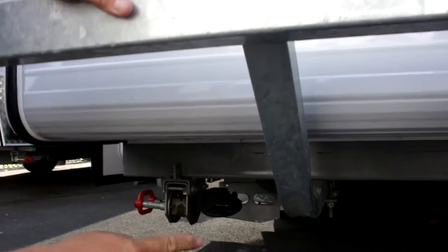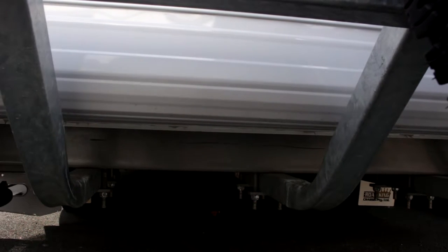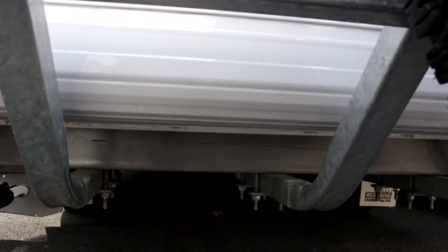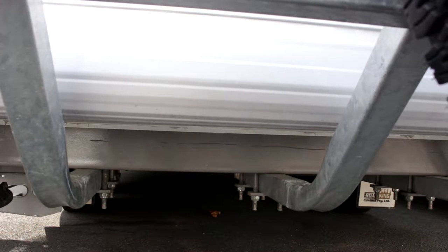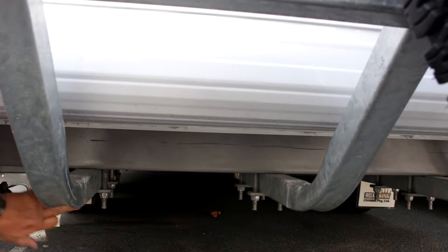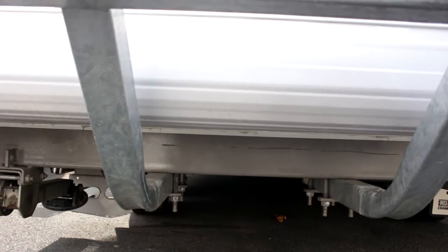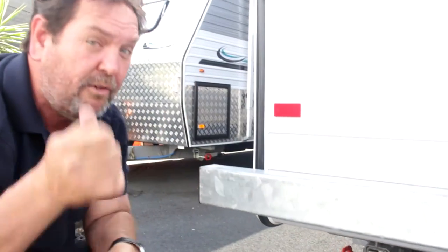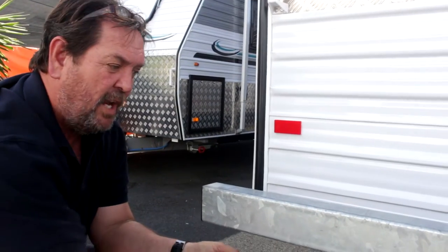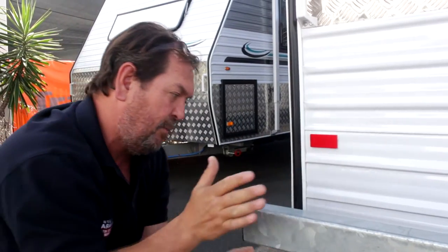If you get down low enough, you'll see these arms — that arm goes back through some bolts. This bumper bar happens to have four brackets; that's not the norm, this is a reinforced bumper. A normal bumper bar will have two brackets, one either side. If you undo the front and rear bolts on all these arms, this bumper bar can slide out — you can actually move it away from the body. That gives you flexibility if you need to put something wider on the back, or you can pull the bumper bar forward to shorten the overall length of your van.